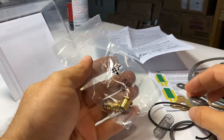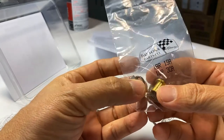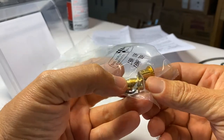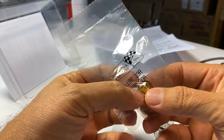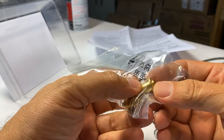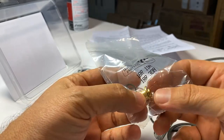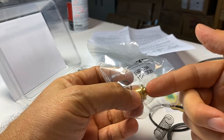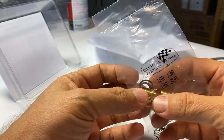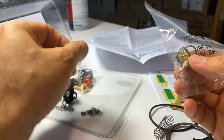Got the spark control valve here. Notice that we have two seats in here for your needle. One is the screw-in variety — you can see the threads. That one is a smooth bore. A lot of '55s and prior used a smooth bore for the seat with a spring that kept tension and kept the seal, but of course that was kind of prone to leak — it didn't have a strong enough spring. I highly recommend that you use the threaded seat.